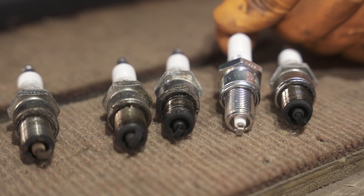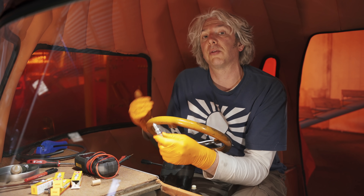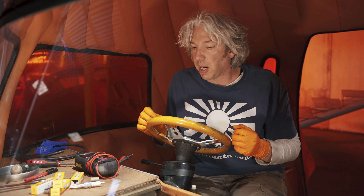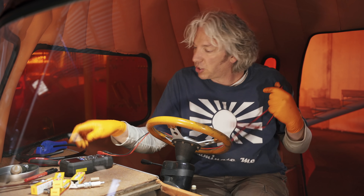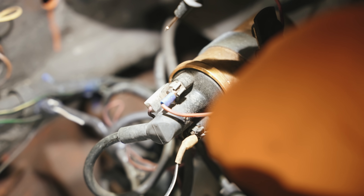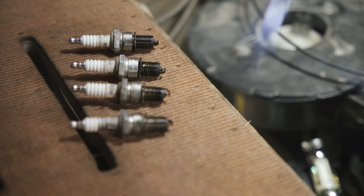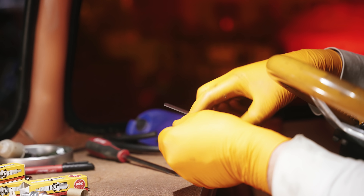The key is to make sure I've got the right gap on the spark plug — something that nowadays is probably less and less talked about. When they come out of the factory they have a given gap, but it's not necessarily the right one for your car. In this vehicle, it depends on what coil you're using. There are usually two sizes: a 1.5-ohm coil and a 3-ohm coil. I'm just setting my multimeter to resistance and connecting across the terminals — reading 2.8, 2.7, 2.6 — so it's about a 3-ohm coil, which means I can afford to up the gap a little bit. On an engine of this size, we're looking for a gap between 25 and 30 thousandths of an inch, so I'm going to go for 30 thousandths.